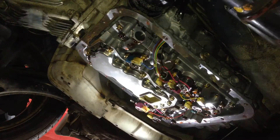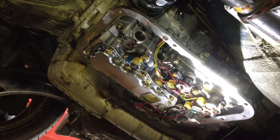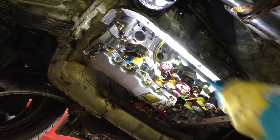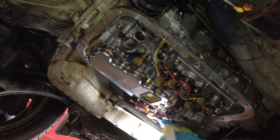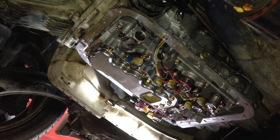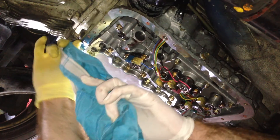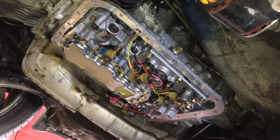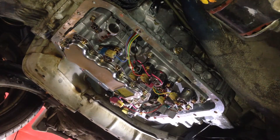That's on. So now just need to finish cleaning the flange for the pan, then the main pan can go on. For that I'm going to use a bit of wax and grease remover on the mounting face just to clean any oil off the flange. Make sure that the sump plug is tightened back up and everything is cleaned out before you bang it back on — get your bolts and everything ready handy.